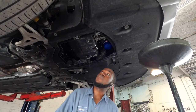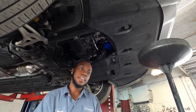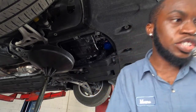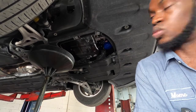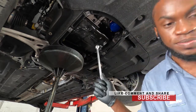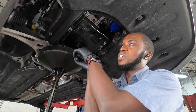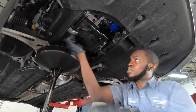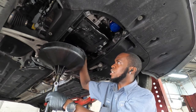Wipe off any spill and then move toward the back where your drain plug is located. That's going to be a 17 millimeter bolt. Get your 17 millimeter wrench — link will be in the description — and push counterclockwise to loosen it. There you go, that's released.